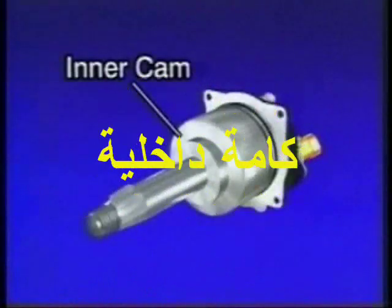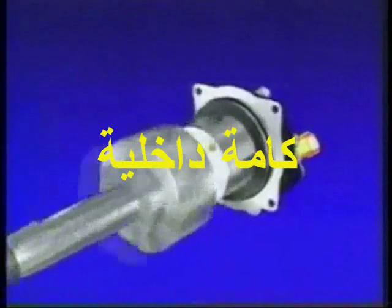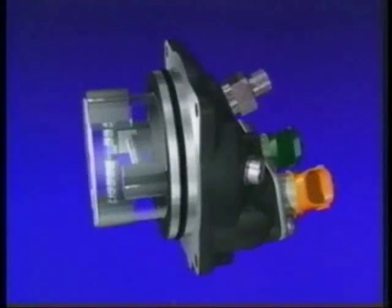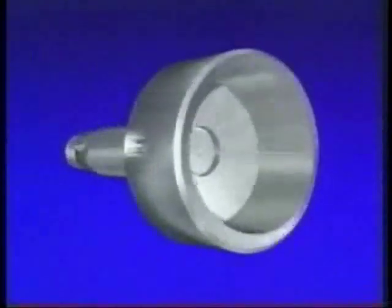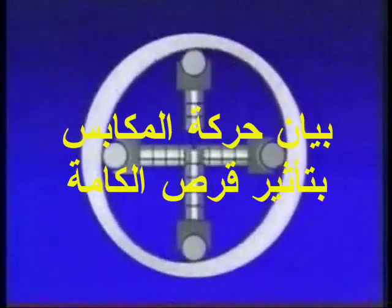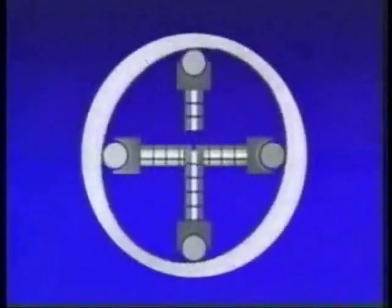Let's look at the supply pump's internal construction. The supply pump contains an inner cam which is driven by the engine. On the inside of the inner cam there are two sets of opposing plungers, positioned at a 90-degree angle from each other, with each plunger operating independently. The tip of each plunger is provided with rollers that come in contact with the inside of the inner cam, which is oval-shaped. The rotation of the inner cam pushes the plungers via the rollers, which effectively pumps the fuel. The use of two opposing plungers minimizes drive torque fluctuations, making for quieter operation.